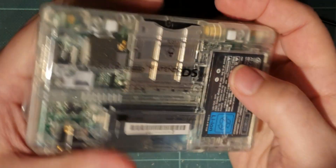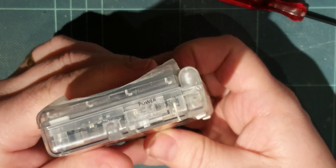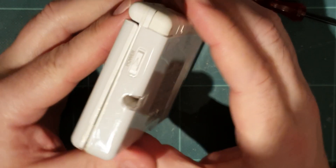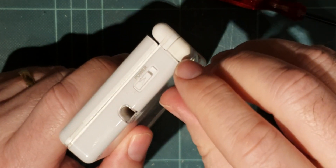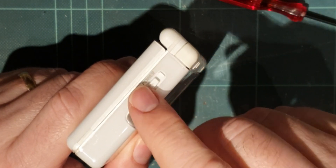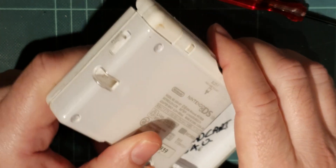Someone said that their power switch had stopped working. Now, of course, it could be something with the battery. But if you've had your DS apart, the chances are you might have killed the power switch when you put it back in. Here's another one — if you've watched my channel, this is one of my Japanese ones that I've still got to fix. But this power switch, it's not springy anymore. It's just like a piece of plastic flopping from side to side, because that's exactly what it is.